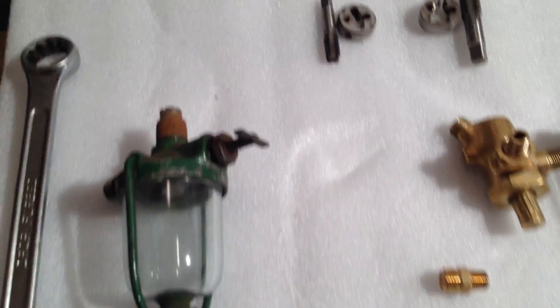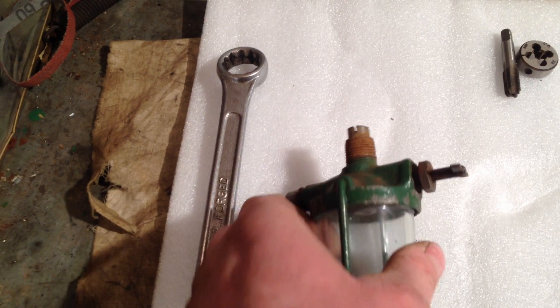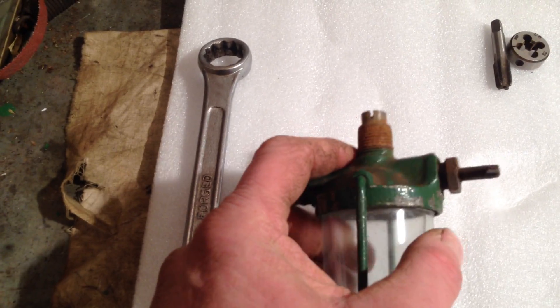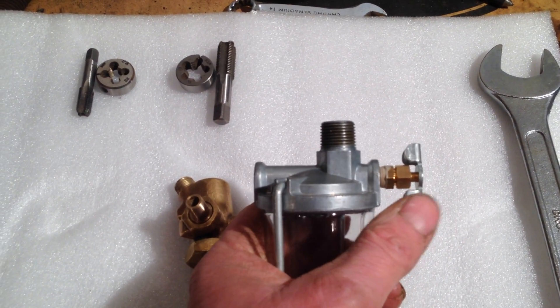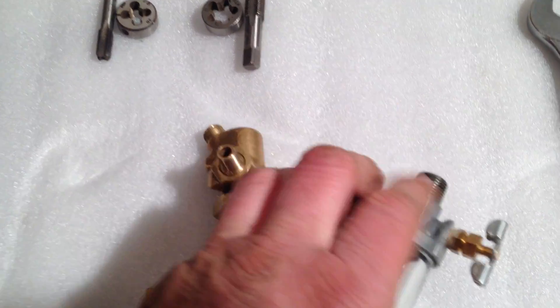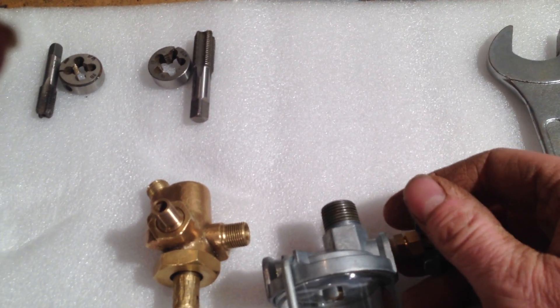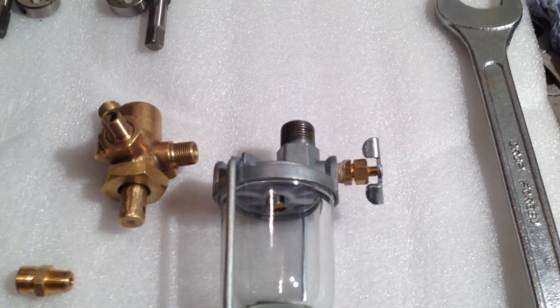You can still buy this as an aftermarket reproduction, but I've seen them and they still use this type of tap inside. To be fair I haven't tried one and they might be a lot better, but I suspect they probably aren't really. So what I do is buy this more modern type version where it has a proper tap on it. The idea is that this screws out on a thread as a tap would, and then when you tighten it back in you're tightening it against the seat, and effectively the tighter you get the tap the more it turns the fuel off and won't leak.